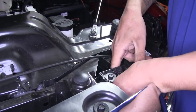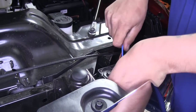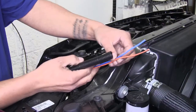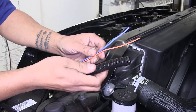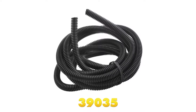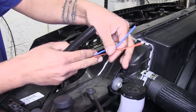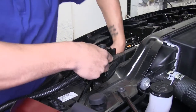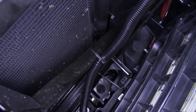Make sure you don't rub against anything sharp or the radiator and condenser because those will get hot — stay as far away from those as you can. Put a couple zip ties back there to keep everything nice and secure. To help hide the wires behind the grille and protect them, use a little bit of wire loom — this isn't in our kit but you can pick some up on our website or just wrap the entire length of wire with electrical tape. Leave yourself a little bit of room to work with the wires at the end. Slide it on and secure it with a couple zip ties. To keep the loom from sliding, put a little electrical tape around it and the two wires, and on the grille support put a zip tie to hold it nice and tight.